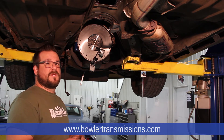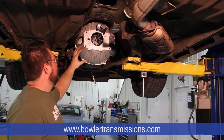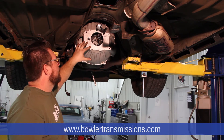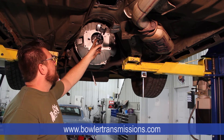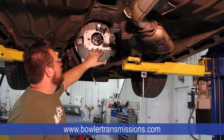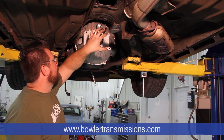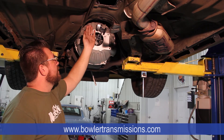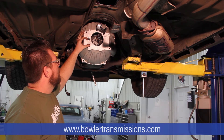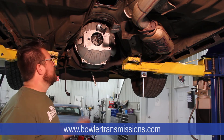Now we're checking bell housing parallel to the block alignment. Flywheel runout has been checked and confirmed good. The bell housing is bolted on with bolts torqued down to spec. I've got the dial indicator centered up on the flywheel, and we're going to mount the dial indicator so that it's reading the circle of the mounting flange for the transmission itself — it's just as critical that this is parallel with the block. One trick: if you've got a bell housing with a pivot ball hole in it, just put a piece of clear packing tape over that hole so the needle has something to ride across instead of falling into the hole.